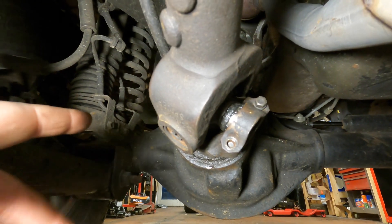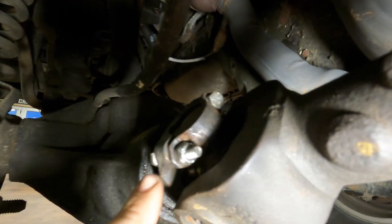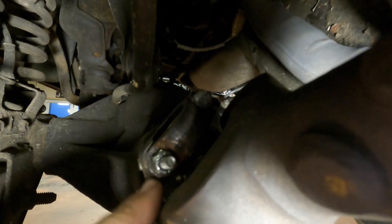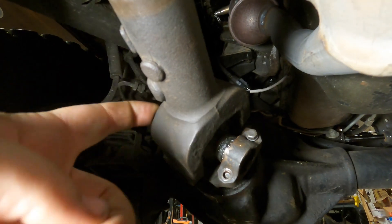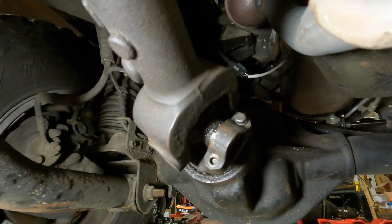So we're under here with the front axle. I really did not do myself any favors when taking out the transmission the first time - I had to remove the drive shaft and all the bolts came off fine except for one, and it broke right off. I figured I'd just drill it and nut-and-bolt it, and that worked. But then I went to tighten the next one and that one snapped right off too. Out of frustration, I ordered the new yoke.